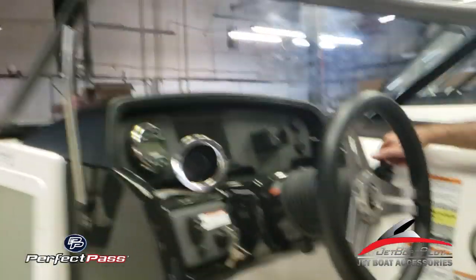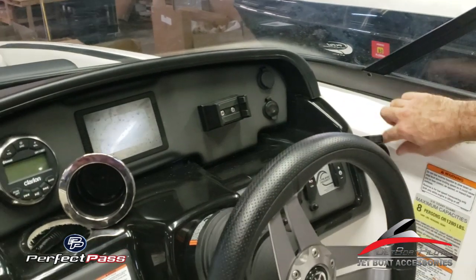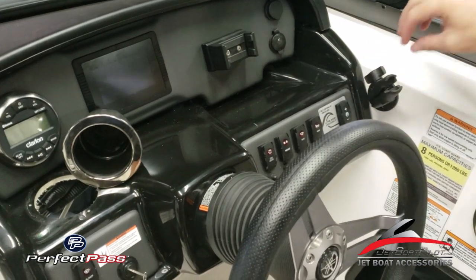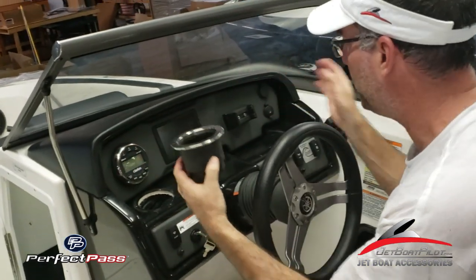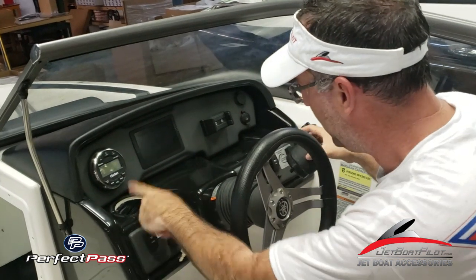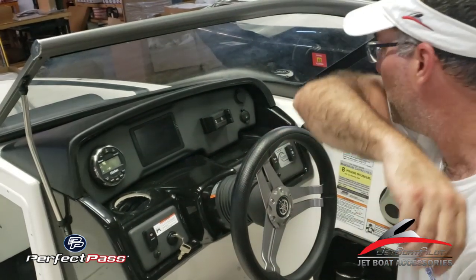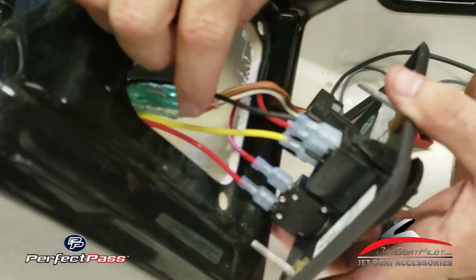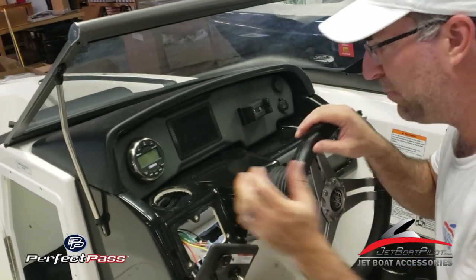We went ahead and installed our RAM mount right here on the side, right up near the dash. We used adhesive that comes with the kit — just prep the area with acetone, let it dry, peel and stick. It's good to put the knob on the backside. You can orient it however you like. You'll notice the cup holder is out. To remove it, you pull the dash off, turn the wire behind the dash, rotate the trim ring off, pull three Phillips-head screws, and pull the cup holder out of the console. There's a drain hose connected to the bottom, so you'll need to pull that loose from the inside. We also pulled the nine-millimeter bolts loose inside the console to get the switch out — just three simple nine-millimeter nuts backed off — so we can work with the wiring in a moment.